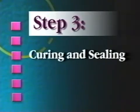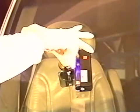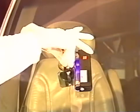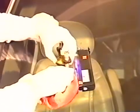The third step in your repair process is to completely cure the resin and seal the impact point. To remove the Tri-Glass bridge, you must hold the injector base with 2 fingers, totally unscrew, and remove the injector press. Only then do you release the suction cup lever and remove the bridge. Wipe away any resin with a clean, dry, lint-free cloth without contacting the suction cup lubricant.